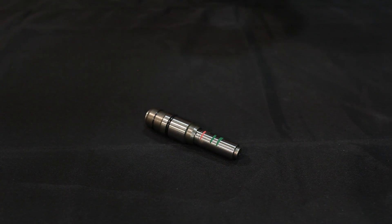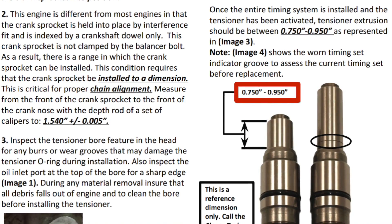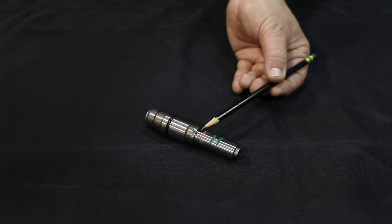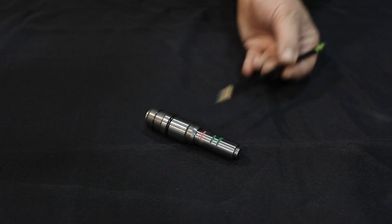The green marks show a healthy range of extrusion that we have measured to be between 750 thousandths and 950 thousandths. The red mark shows the current state of extrusion in the used engine, and this is the indicator groove that signifies the end of the tensioner's functionality. As you can see, this used timing system was on the brink of failure.